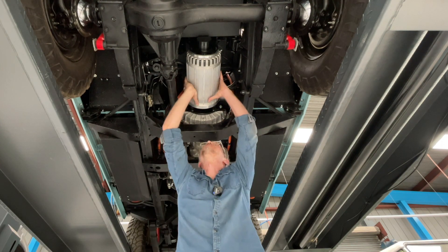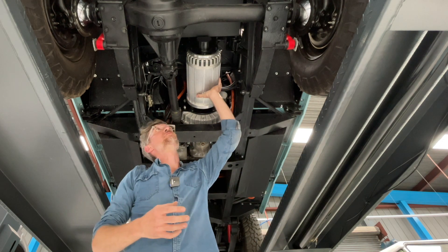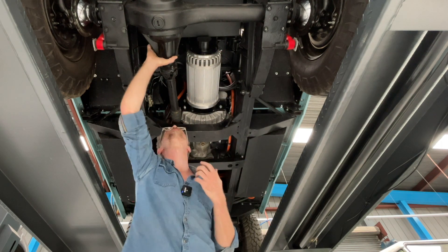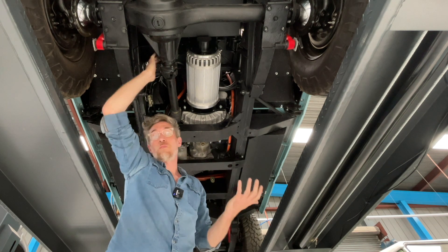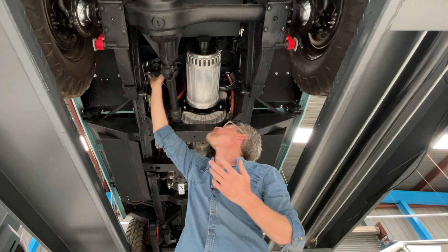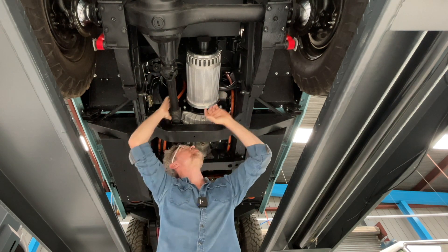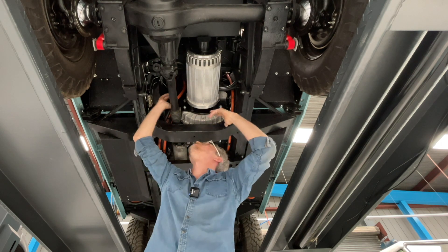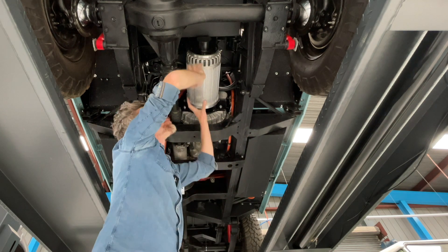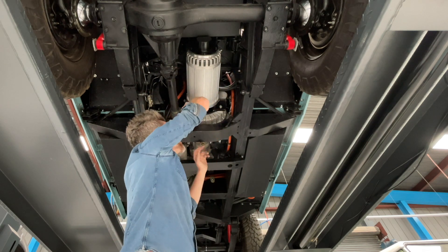This is the electric motor installed in the car. In context, you get a sense of just how small it is — it's 50 kilos in weight, really not much bigger than a differential, particularly the Salisbury differential in the back. That's good because it's more space for batteries and ancillary systems like the brake vacuum pump. You can see all the high-voltage cabling in orange coming from the side battery packs, 12-volt wiring, and control and management wiring for the batteries in the black cabling. You can also see the front mount plate going to the original engine mounts and the adapter plate into the original transmission.